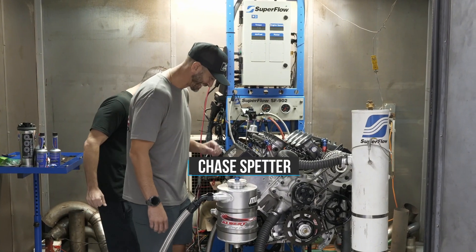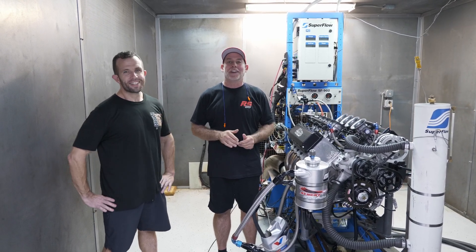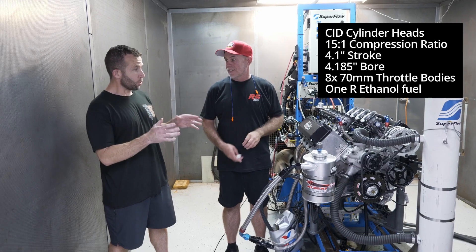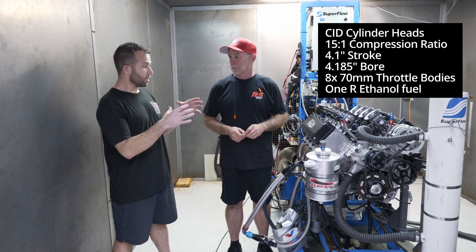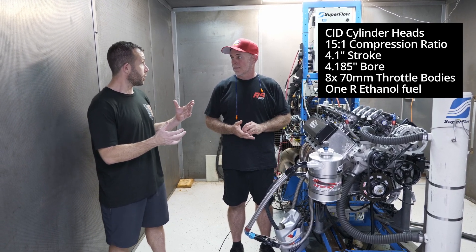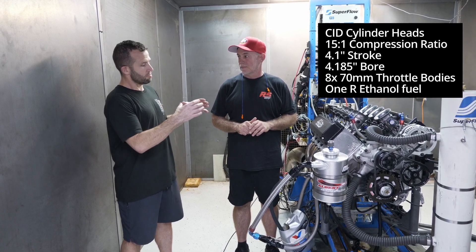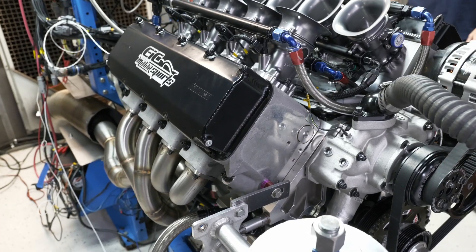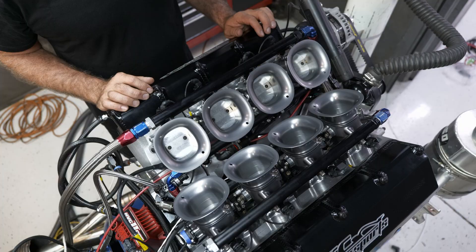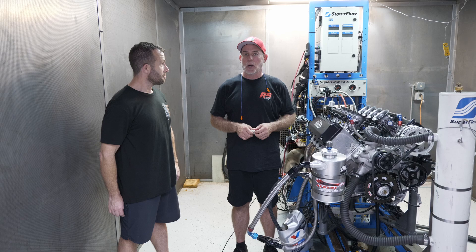This is an LS engine — well, kind of. It started as an LS. It's 450 cubic inches and it has essentially a Ford cylinder head. It is a Ford cylinder head that they moved the bore spacing out so it bolts to an LS small block Chevy, which is 4400. A small block Ford is 4380, and that's a 4400 block. So when they made the heads, they just spread everything out just a bit — and not only that, they switched where the intake and exhaust valves are. So if you look at this, it's laid out like a Ford rather than an LS. So it's both.